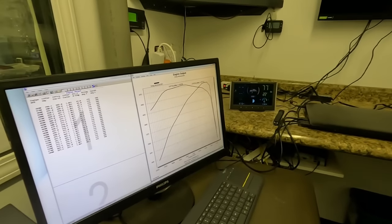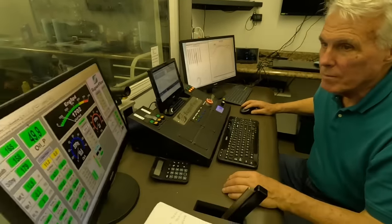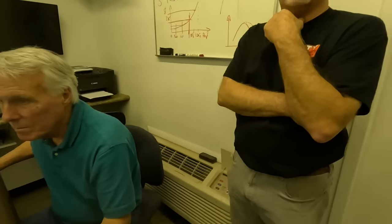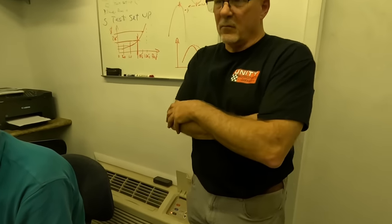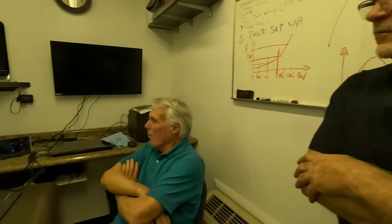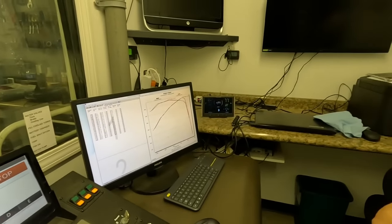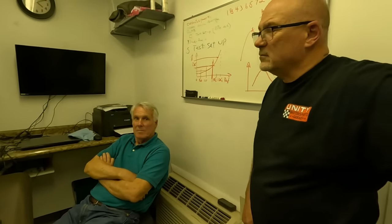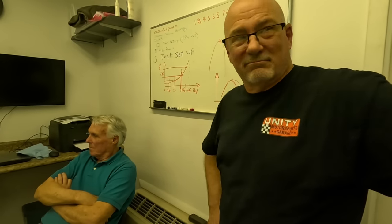About the same, isn't it? Yeah, so we pretty much have found it. We can overlay it if you want. I think we found it. 32. No, 30. Probably 32, 33. Yeah. We could back it up a degree. Yeah, it's almost an overlay. Oh, wow. So how much timing do you have in it now? 34. So I'm going to back it up a degree and then see what happens. I like it alone. Leave it alone. You the man. You tell me. I'm with you. I think I'm good.